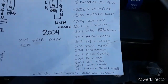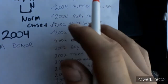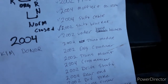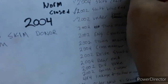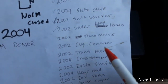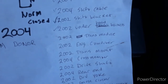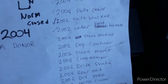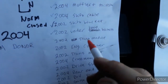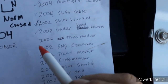I was worried the security system was built into the body module. I don't know for sure if it is, and I think I'm going to have to go to the 2004 body module. If you look up how to bypass the SKIM system, it says nothing about replacing, bypassing, or reprogramming the body module. So I don't think the security system is built in - and I'm talking about the part where the key has a chip in it when I say security system.